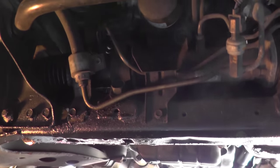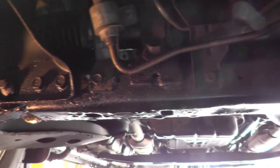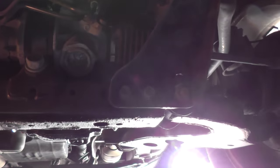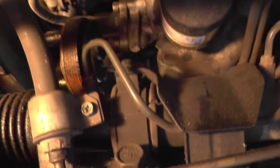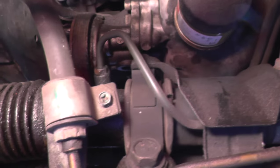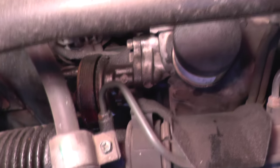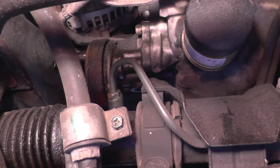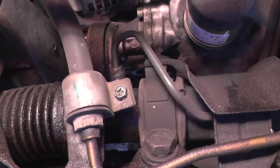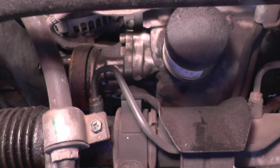My Pathfinder has been leaking oil for probably a couple of years now, very slowly. It seems to be getting a little bit worse with time. There's a lot of oil build up along there, and it kind of trails down this way. But up higher, you can see right in there — that's about where the oil leak starts, right on that circular thing. That's the oil cooler. So at this point it's going to be a matter of getting that off to change the oil cooler gaskets.